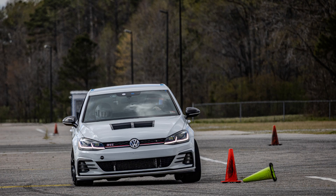So we've established that these ball joints are really good for adding camber in general, and they also help the camber curve — which is always a welcome thing on a strut car. They do have one downside: bump steer. Most people aren't going to notice it and that's fine, but the fact is it is there. We're going to be looking at that in depth in the next video — which will probably be a few months out due to lots going on. I've got a few solutions: one off the shelf, one a custom machined solution to correct that bump steer.